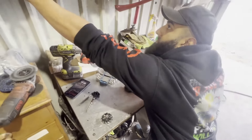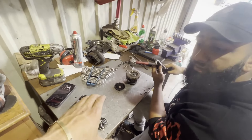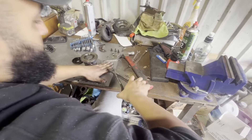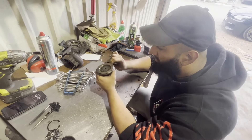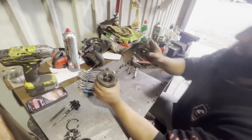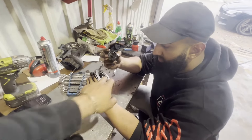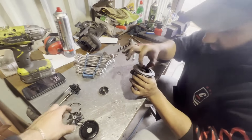Same pliers - careful with these when you undo the snap ring. Put your hand over it so it can't fly out because that will fly. That was clean. And what's this plate? That's the seal plate - it goes together with the front seal, that's what stops the turbo from leaking oil out on this side.